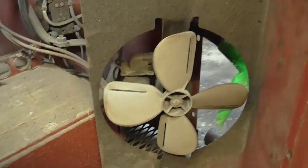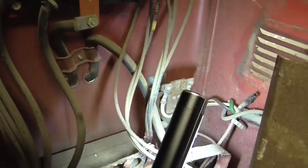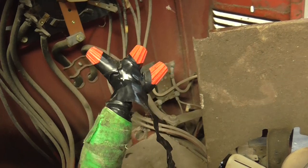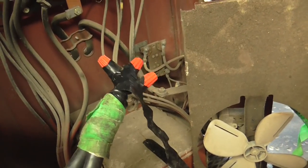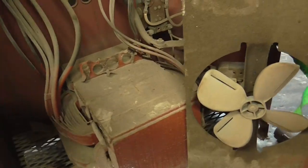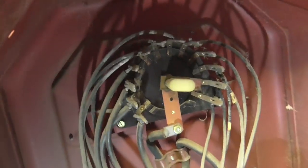A couple of random spiders and whatnot. The fan is probably in need of some lube. What I'm going to do is take the power wire — it's got a non-UL-listed splice in the middle of it. It goes from 8 gauge down to 12-gauge 3-conductor SO cable. Apparently the 12 gauge SO cable isn't adequate to carry this load. I never noticed any heating up when I used it, but it just doesn't fall within the rated spec, so I'm going to get rid of that.